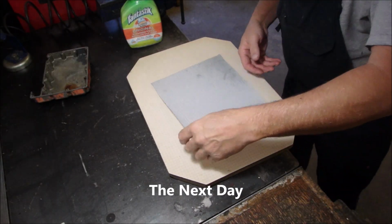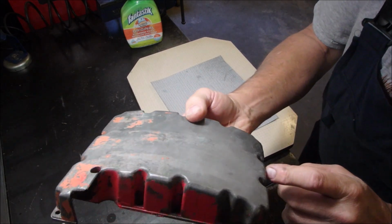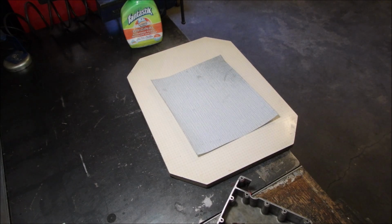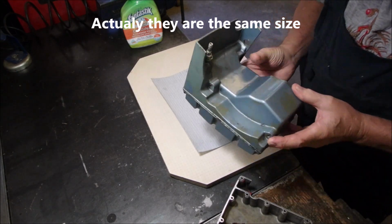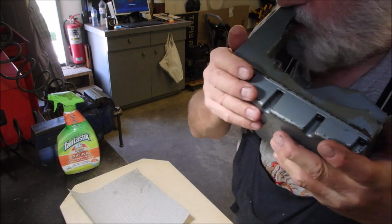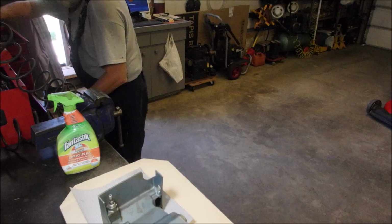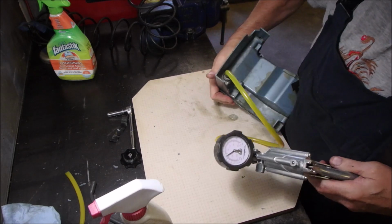All right, my friends, we're still working on the chainsaw. Now this repair for the leaky gas tank, I think is good. And so is the one for the bigger bodied tank, although I can use them in both, in either saw. There's two missing. Let's just see if that makes a difference. Let's just pressure it up with the pressure tester. Okay. Now we watch it. Okay, here we go.